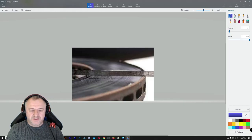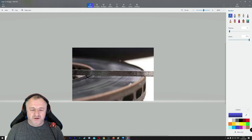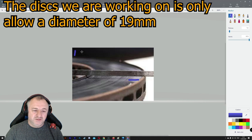Right, so we're looking at a disc here that is quite badly worn. There's a point where you say we can't use this disc anymore, and that is when the manufacturers say the disc mustn't be thinner than a certain thickness. So about 10 mils in from the edge, you measure the thickness of the disc with a micrometer, and that should not be less than 19 millimeters